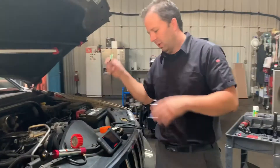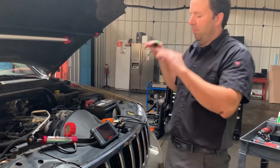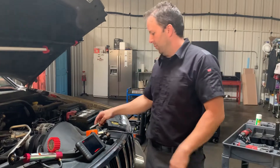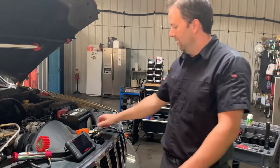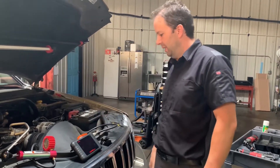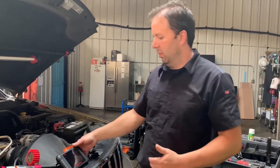I swapped the spark plugs and did a quick check swapping the front cylinder coils and plugs — the misfires stayed in those two rear cylinders. From there I performed a compression test on cylinder eight, the passenger side, and got zero PSI — zero compression at all, not even a slight bit.